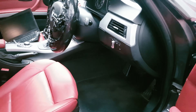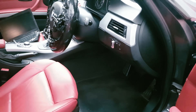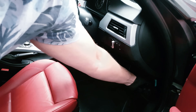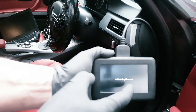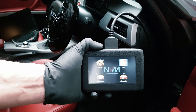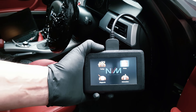As a self-contained tuning module, we need to connect to the OBD port. On this vehicle, which is the E92 335D, the OBD port is just there on the A pillar. Once connected, you'll see the system start up. It is self-contained, but we advise you to stick on a battery backup or a battery charger to the vehicle.